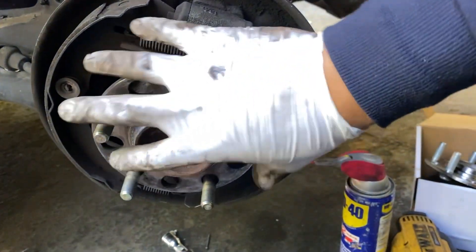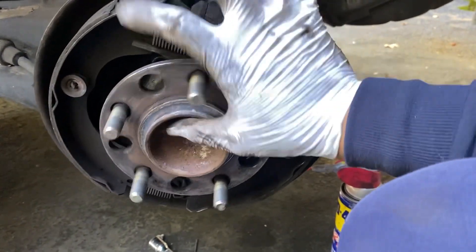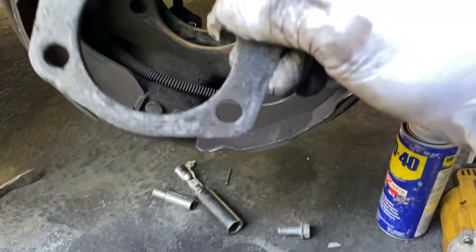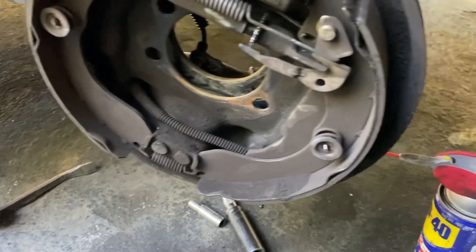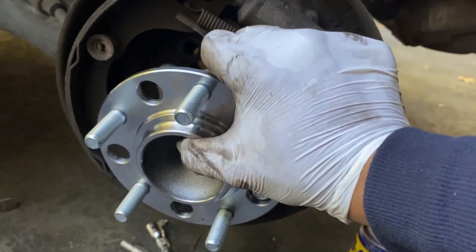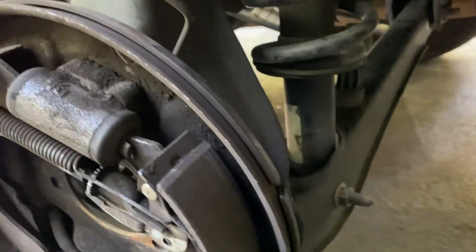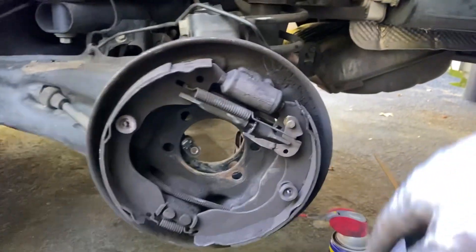Let's go ahead and pull the bearing out — it might be a little bit stuck but you can hammer it out. There we go. Also, this one's going to come off — this one goes in the back right here, so make sure you don't forget to put this back on first before you put your bolts back on. The new bearing just slides in here like this, then you put this right behind that and align it with one bolt first, then you can put the next one. Make sure you hand-tighten it first, then you can go in the back and tighten everything up. Don't forget your sensor. Also make sure you clean all this out with brake cleaner.